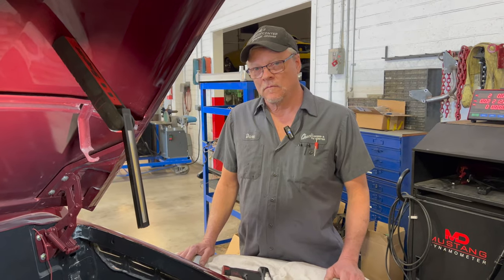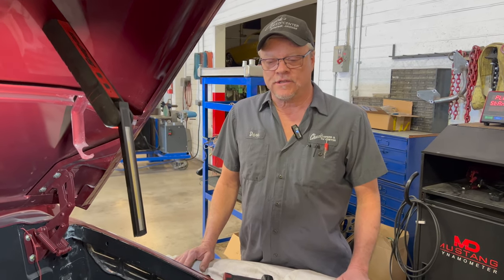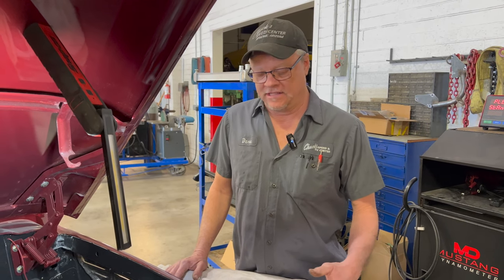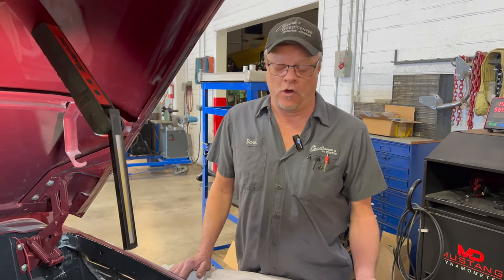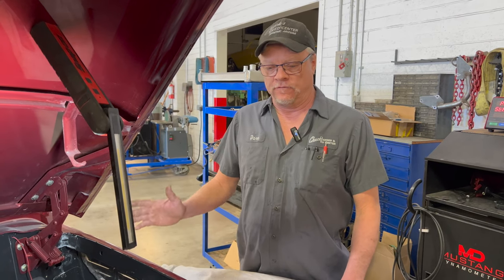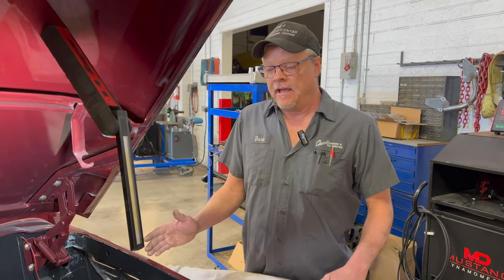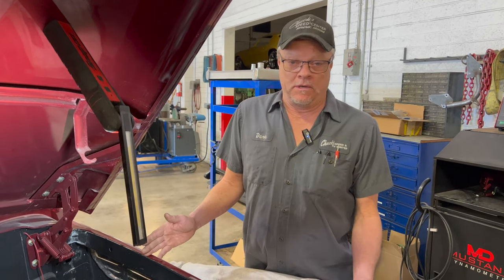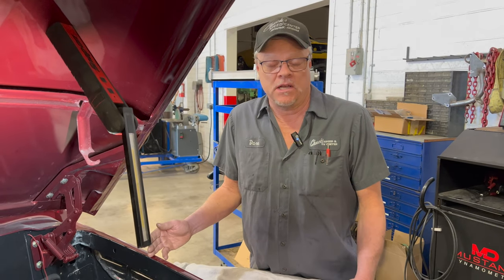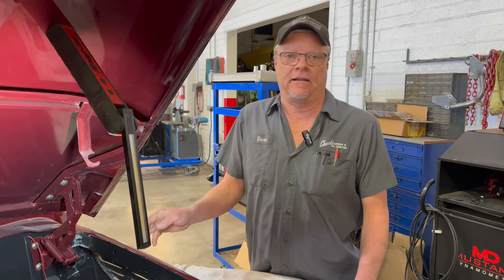But how do you basically go about troubleshooting a strange old car? It still works on the same principle: it has to have certain things. It has to have fuel, it has to have spark, it has to have compression. That's true of all motors. My situation is always starting off at a base and making sure that it has everything it's supposed to have. If a car is not running, it will be missing one of those things. So it comes down to kind of a puzzle. Figure out what it doesn't have, find out why, fix that, and move on.